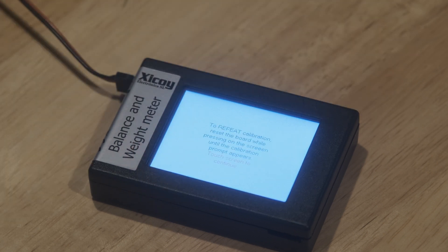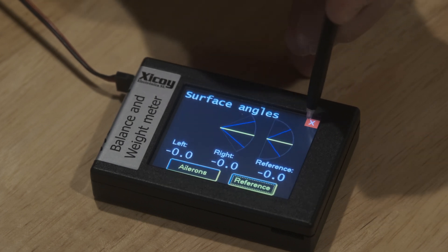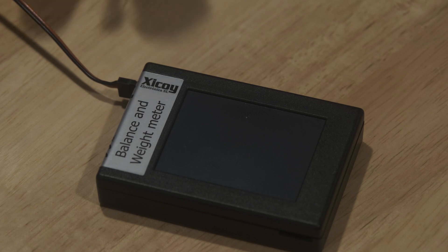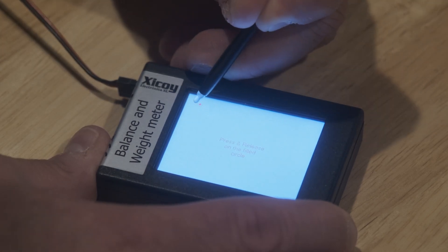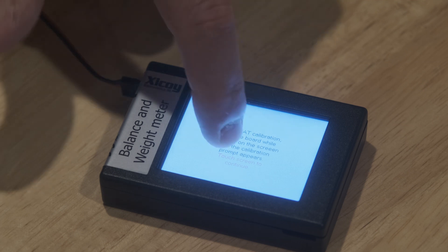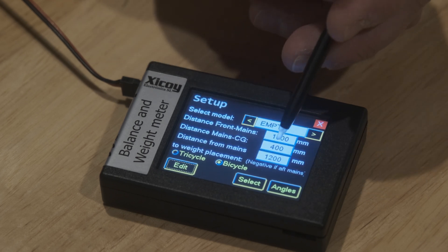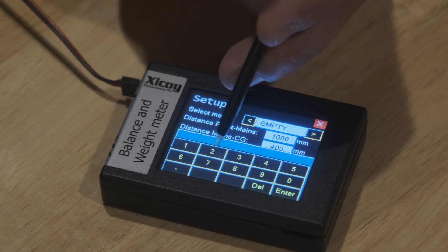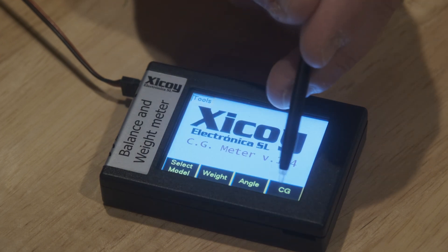One last thing: I'm using my finger, and your finger is pretty big compared to that stylus. In this case, I can't seem to hit that X near the edge. I find if you use your fingers, things near the edge you can't click on very well. So go ahead and calibrate it using the stylus you're always going to use — take your time, hit each one of those dots as carefully as you can, and you should be good. The key point is when entering values because the little keyboard is kind of small. Tip number three: screen calibration mode if you're having problems with your touchscreen response.